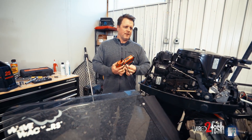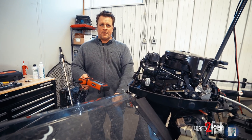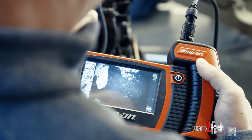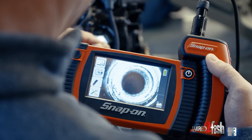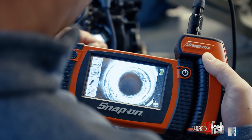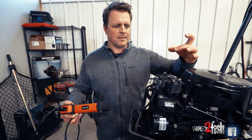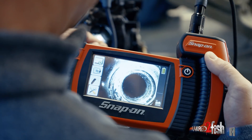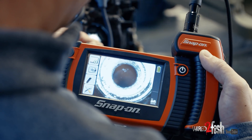Engines are different — a lawn mower could be a pull start. I'm just going to pull the recoil like on this older two-stroke. That's moving that cylinder. It kind of broke any seal that may have formed where those piston rings are seated against the cylinder wall, and re-spread those lubricating oils — just helps prevent corrosion within that inner cylinder area.